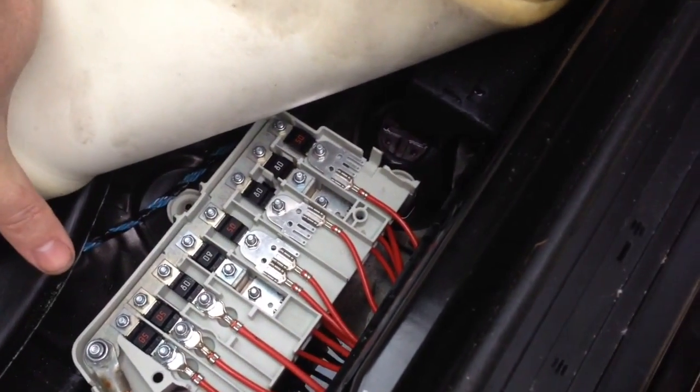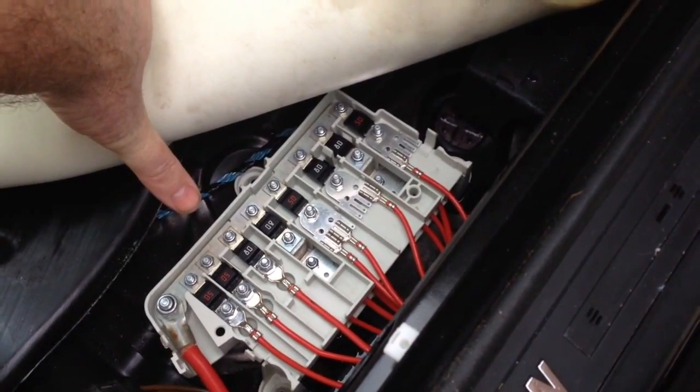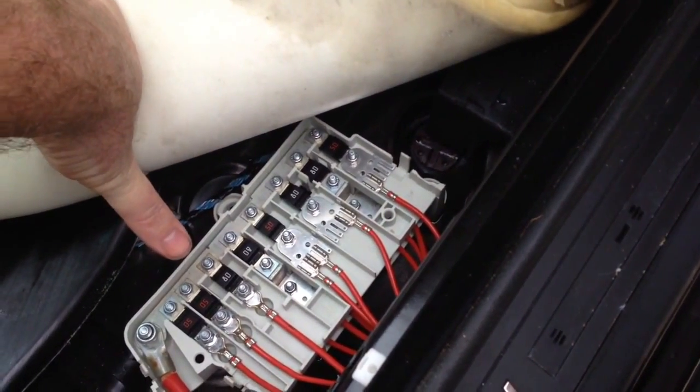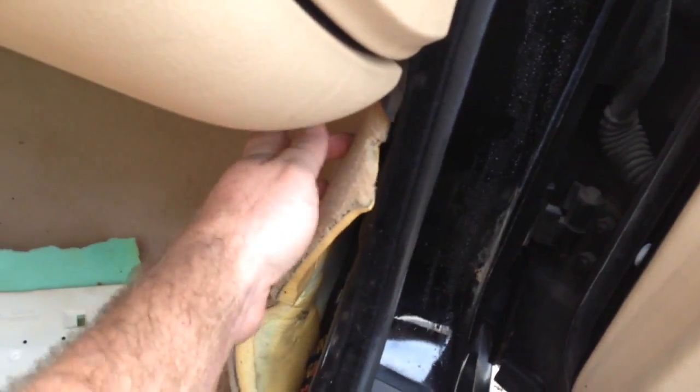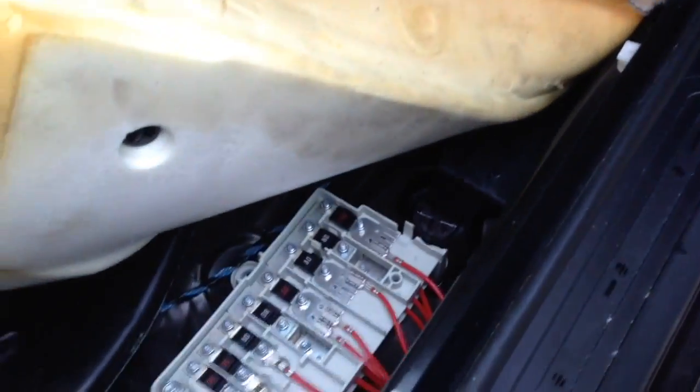This one is not. Now, our seat problem, our tilt steering wheel problem, and not starting could be one of these fuses, or it could be the GM5 module, which sits right on the A pillar up in here. And if anything leaks, it leaks down through the GM5 module, runs all the relays in the circuit board, and then goes down here and runs this stuff.